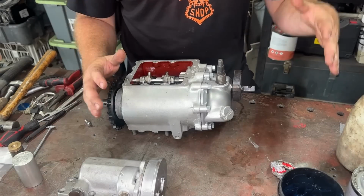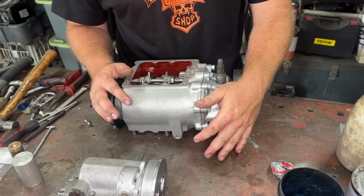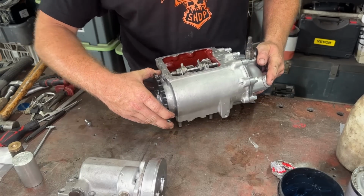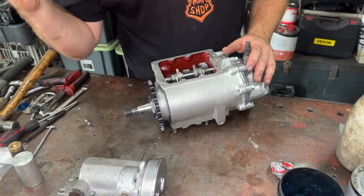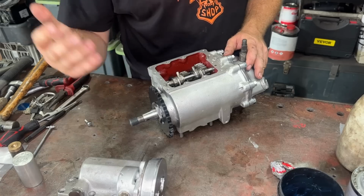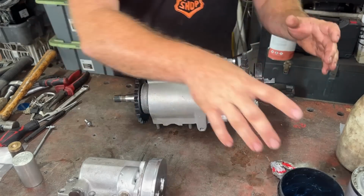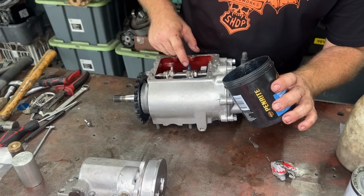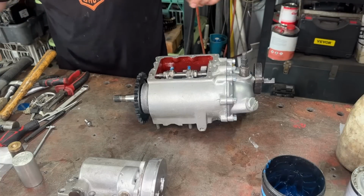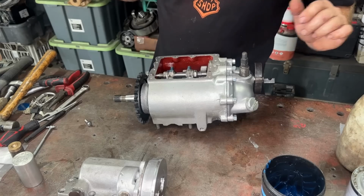Basically, the last thing I got to do on this gearbox, a few of you might have noticed, I forgot to put the throwout bearing in here, so I went back, put the throwout bearing in. I went and put a 25 tooth sprocket on this thing. Yeah, 25 and 26 is literally the best highway gear. Like if you still do around town stuff, 26 is probably a little bit big. You want to go with 25. So that's what I've done with this thing. Really all we got to do next is put our lid on. I'm going to do a timing video in another episode. I won't do it in this one. You guys are probably bored already and changed it anyway.